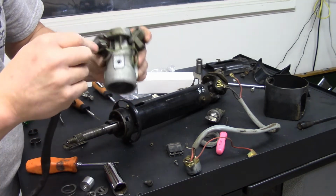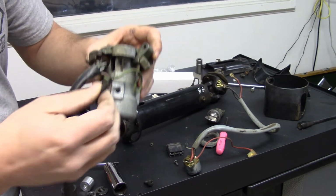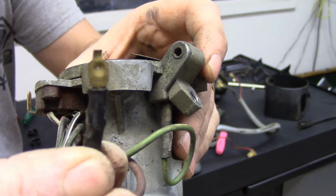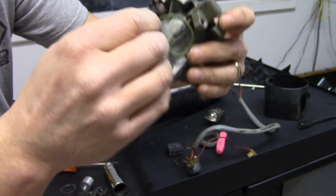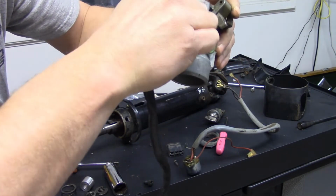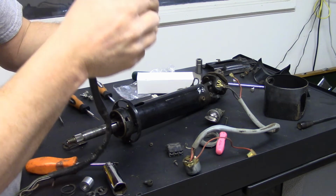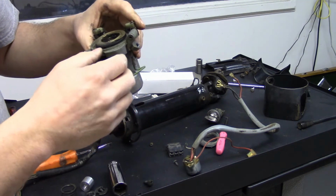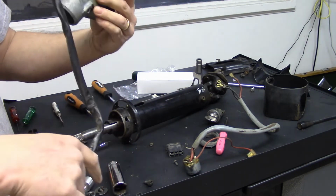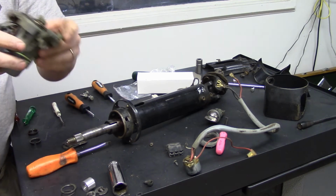And then you've got these horn connectors that are wired in under here, and it'll pull out, and it's a kind of weird little spring connector. I'll try to get as close as I can. And there's a little slot up there that it connects to the ring, and there's a plastic piece, and it'll kind of detent in there. But sometimes it seems like you just wonder if that's a good connection or not. And it's a good chance to kind of get familiar with it. Sometimes, like I said, the wiring color is different on these, depending on what year and such.